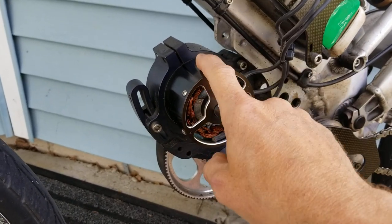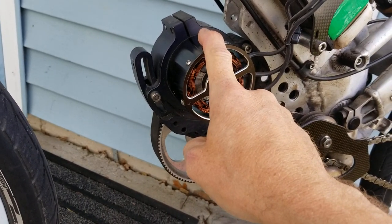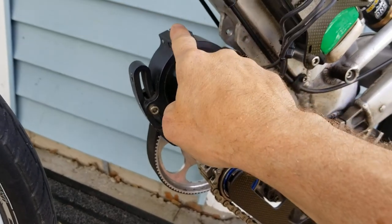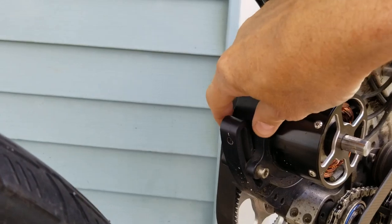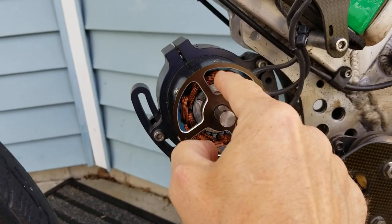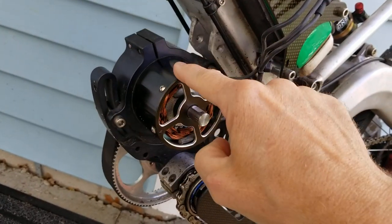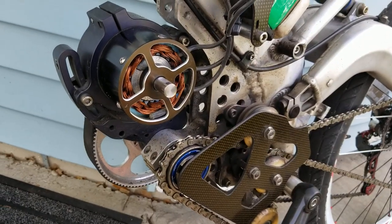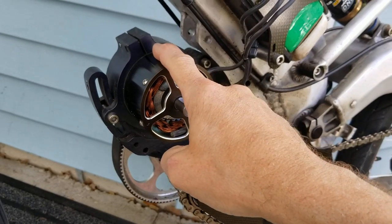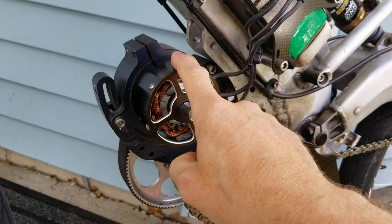In this application, this motor is so understressed it doesn't even warm up, so I'm not using the cooling fan — but that's what the extra shaft and venting is for. I have these motors custom made for me by Astro Flight, the manufacturer in California. The machined and black-anodized drive unit — which I also have manufactured for me — the motor slides all the way through and clamps around the motor can. On a brushless motor, the windings are attached to the can, not the armature, so the can gets hot. When you clamp around the can, this aluminum drive unit becomes a heat sink, pulling heat off the motor can into the framework and ultimately into the frame of the bike. The motor runs at just 5 to 10 degrees above ambient at most. This motor is rated by Astro Flight at 4 kilowatts continuous, but in this application I see peaks of about 8 kilowatts.